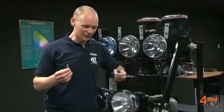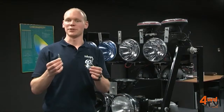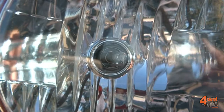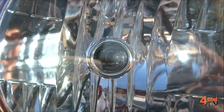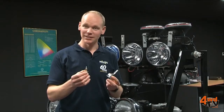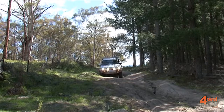Here we are in our lab and I've got two globes with me — a halogen and a HID globe. They both do the same sort of thing; they both produce light, but the way they do it is pretty different. The halogen globe consists of a glass envelope with a metal filament inside. When you flick your lights on, the wire element heats up and reacts with the gas and produces the light. Halogen globes are available in different wattages — the higher the wattage the more light is produced. The way halogen globes are made is pretty economical, so they're reasonably priced and that makes halogen driving lights affordable for most four-wheel drive owners.